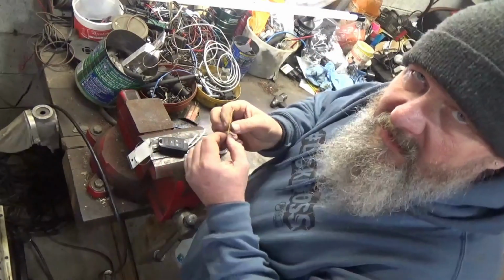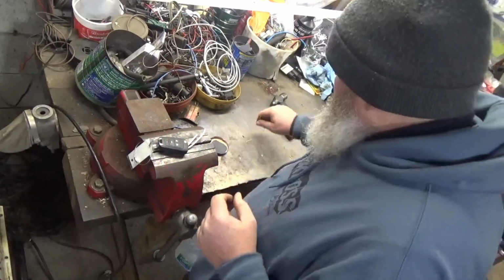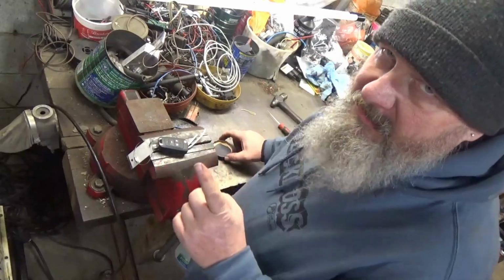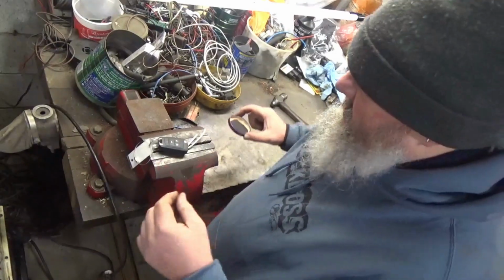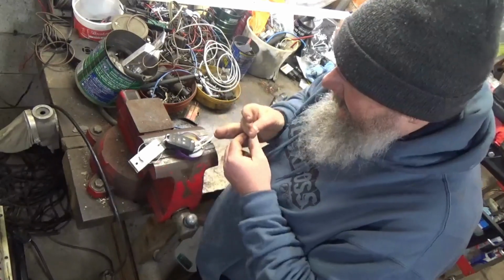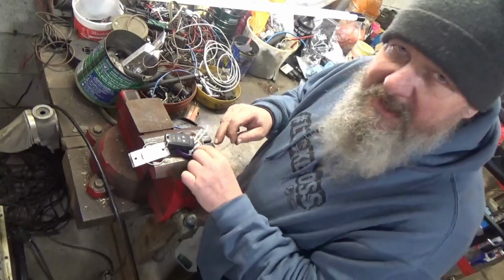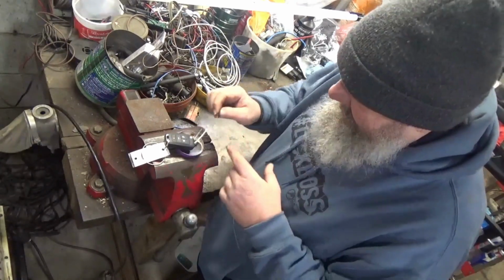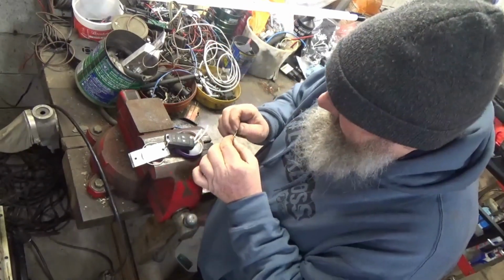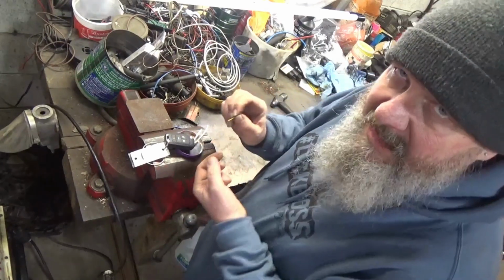is I took one of these bigger style paper clips and I cut a piece off of it. That's going to be my driver to drive it the rest of the way down. But what I'm also going to do is, because that damn little roll pin is so small, I'm going to put this little metal cap off of a sausage jar or something, and I have a little piece of magnetic mat in there so that it catches this roll pin. This is all stuff I had laying around. Then we're going to put our piece in that we cut off, and I'm going to leave the colored coating on it because it'll fit, and it seems to make it a little sturdier.